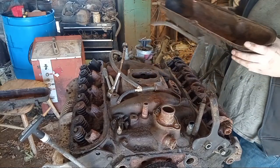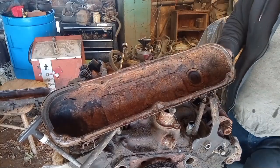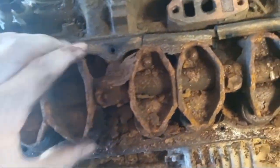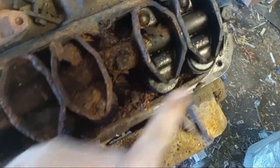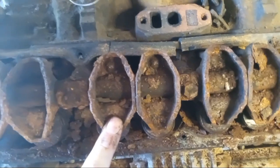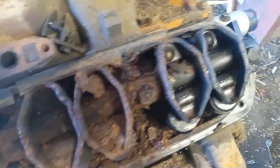This side's the same exact way. Holy cow - maybe even worse. You can see the rockers started getting oil, which is good. But had this motor ran, I'm kind of glad it had a leak - it wouldn't have run very well for long; we'd have clogged something up. Glad we took it out, glad I went with my gut and pulled it out. There's no rust on the top of this into the throttle body, which is significant - that would indicate water intrusion. This is a mystery to me. It's almost like somebody dunked the whole front of the motor into the water.